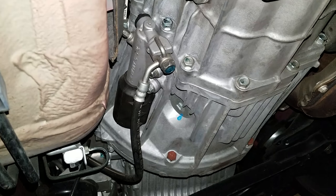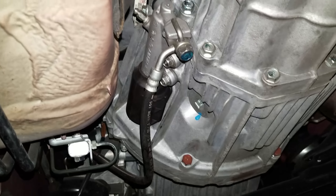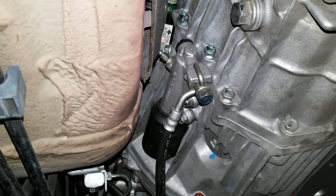You still have the same pressure plate that was used to handling 14 pounds, and adding an additional 10 pounds makes it really hard for that pressure plate to compensate. So every now and then if you're driving aggressively you will feel as if the clutch is slipping a little bit. The best remedy is to swap out that heavy flywheel for an AP1 flywheel — which will fit these cars — or something even lighter. It's something you should consider if you have an AP2, because it really wakens up the car and makes it feel a lot better. I haven't done it on my car yet, but I've driven an AP2 with a lightened flywheel and it's night and day.